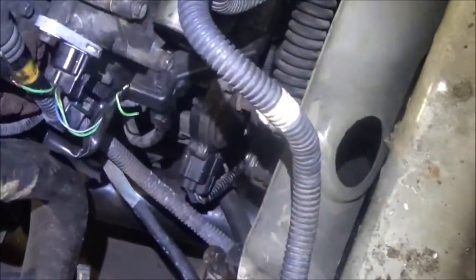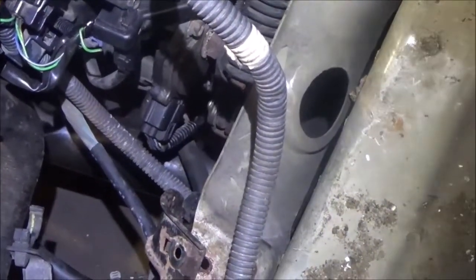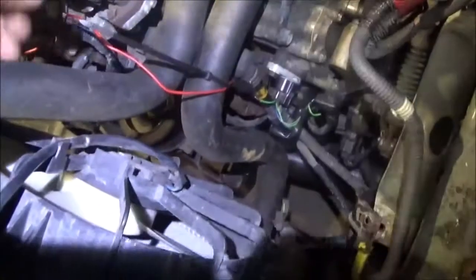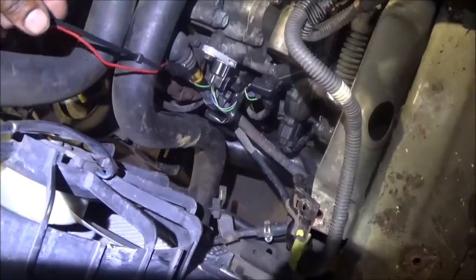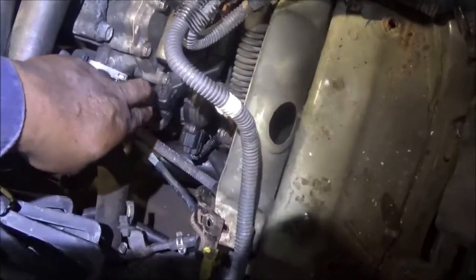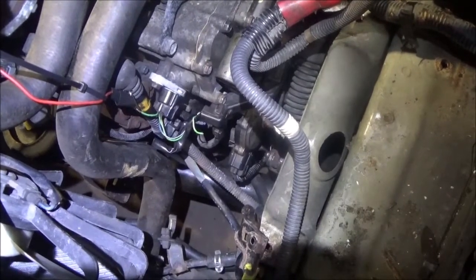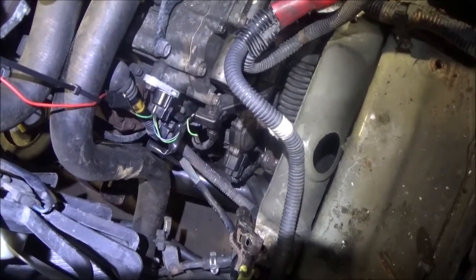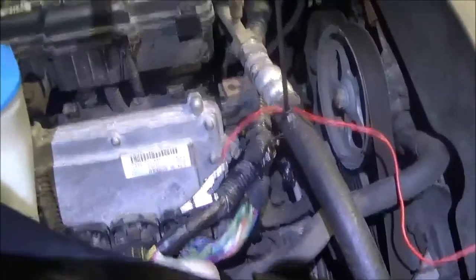Now what I'm going to do is test this wire, or this harness wire. This could have been done, but like I said, I was going to change that solenoid anyway. Also, because I thought about the antifreeze, I'm going to try to drain as much out as I can — it didn't seem to hurt the transmission. I'm going to put a transmission cooler on here and then go from there. I am going to show you how you test this if it had a short to ground somewhere in a harness, a short to voltage, or an open — and I'm going to do it over here by the computer.